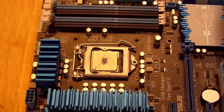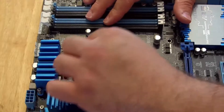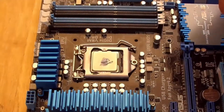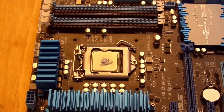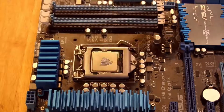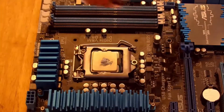I'm going to clean it up a little bit — you can use a little paper towel. That's okay now. It could be better, but I'm not going to focus too much on that because I won't be overclocking. If you're overclocking, you'll want to pay more attention to how you apply the thermal paste to get the best application for better cooling. You don't want pockets of air either. That's going to spread out as soon as I apply the heatsink.